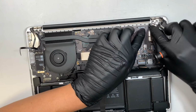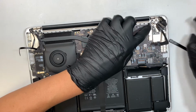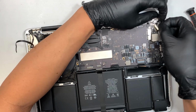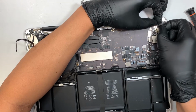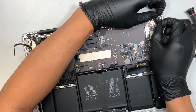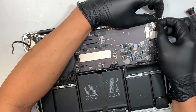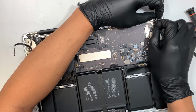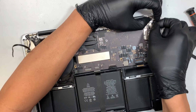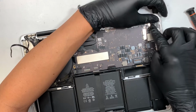Okay, so let's go ahead and install this cable. As I'm working along with the screen now, I'm just going to slide it back to your left. So slide it back in. Take your time, don't rush it, because I do not want you to break the cable or the pin. And if you break it, then yikes, you would have to replace the entire screen. All right, so kind of gently pull it back in. You want to push it all the way in and then get the clipper to clip it back on